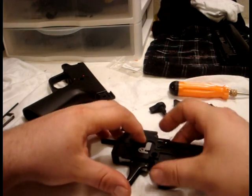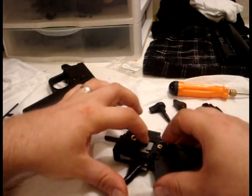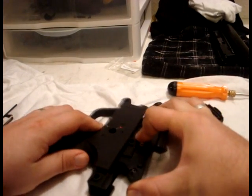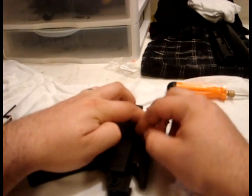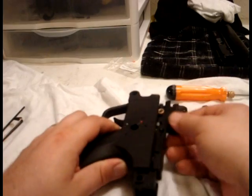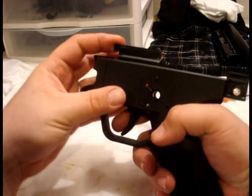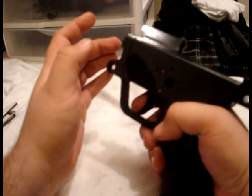Now hold it with your finger, because this little spring is a feisty one. Put your brass bushings on. Keep holding it with your finger. Then slide your trigger pack in. And if one of those bushings popped off, just reinsert it. Snap it in. Make sure that everything's functioning correctly, that the spring is in good alignment. When I pull this trigger it's moving the plate just fine — that's what we want it to do. And it's returning to its previous position.